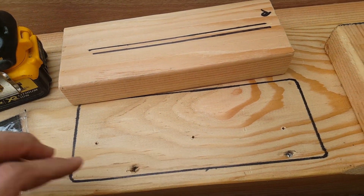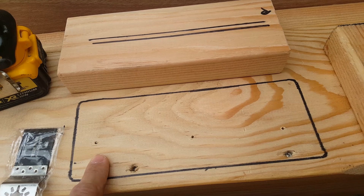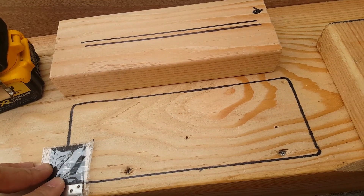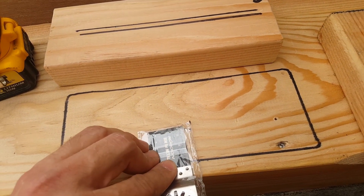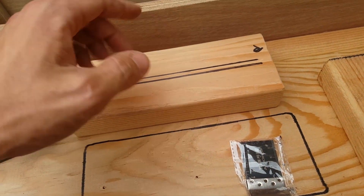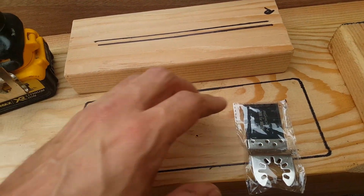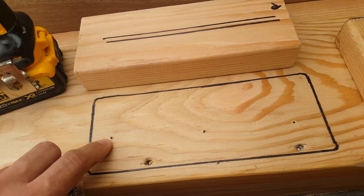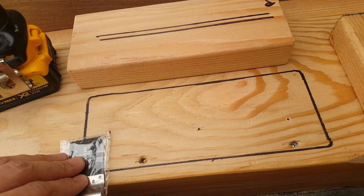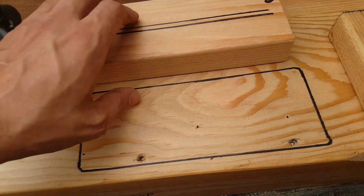If you do it this way and there is something wrong, try to make your screws a little bit closer towards one side. The reason I say that is because if you look — if you do screw up, you can get underneath there with an oscillating blade from the bilge area. You won't have the ability to get to it from this side because there will be flooring already over here. So you want to offset your screws a little bit closer this way so your oscillating blade can nip these screws off if something happens. Just a little tip.